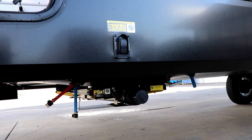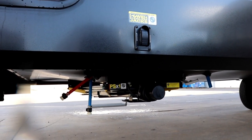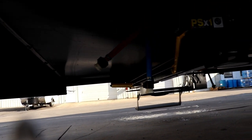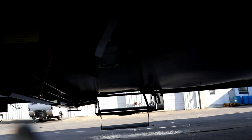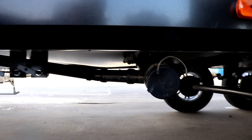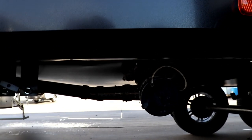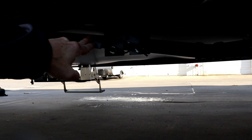This camper comes with power stabilizing jacks — don't confuse them with a leveling system, they're just stabilizers. You extend the front ones and there's a switch in the back for the rear ones. Right past your stabilizer jacks you can see your low point drains, your fresh tank dump — which is the overfill for the freshwater tank — and more low point drains over there for your washer dryer. Just forward of your slide out is where your tank dump is going to be, with two gray tanks coming in: one from the washing machine and one from the kitchen sink and bathroom. Those are all up underneath in the heated and closed underbelly.